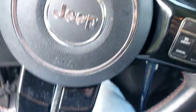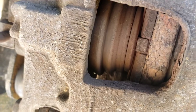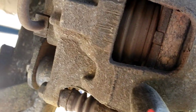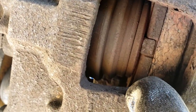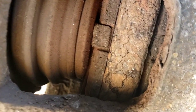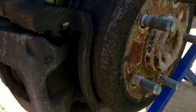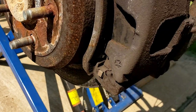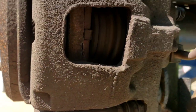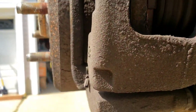Oh yeah. Let's see what that looks like. Right rear brakes - there's a part right there. There's no brake pads left. That's all metal - that's the metal piece. There should be material in between and then the rotor. Look on this side, you can see a little bit of the material, you can see the gap. Brake time. And the left rear is no better - same thing, it's all metal, no material whatsoever.